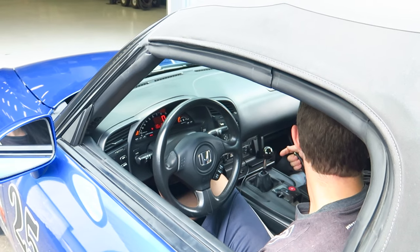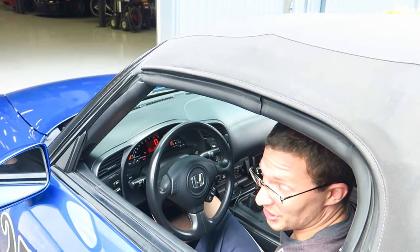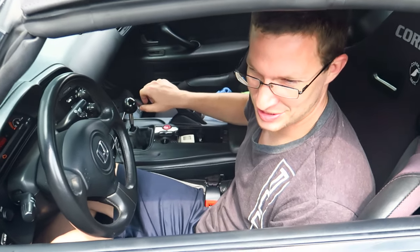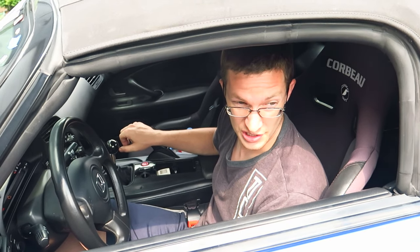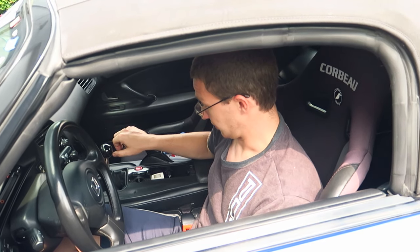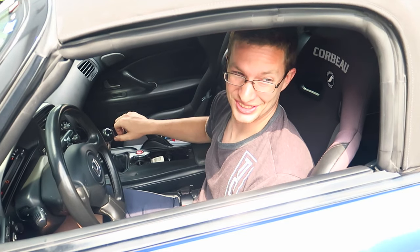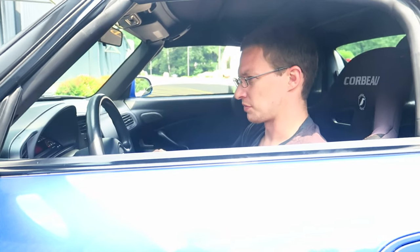It sounds better. I think the plug being loose was also a factor — spark plug number three was almost a full turn out, so it had shaken itself loose. Definitely a couple of things today just from listening to the car. Everything feels pretty good right now — it's not the smoothest idling car, but that's going to happen with a burned-up valve.